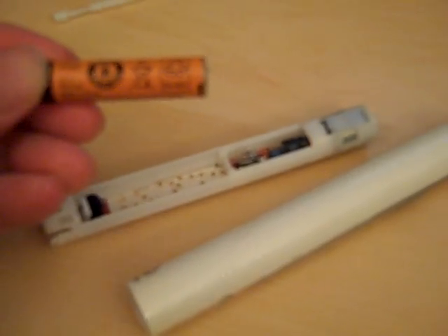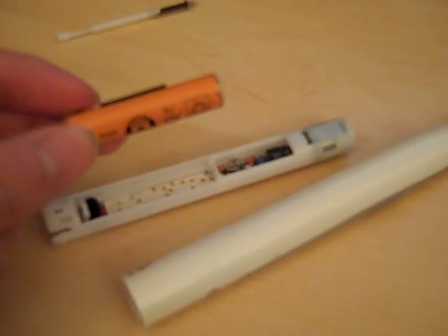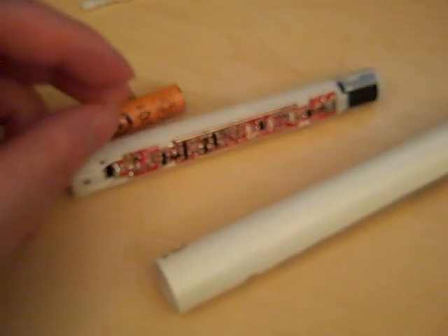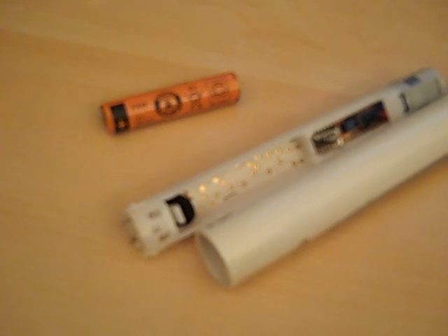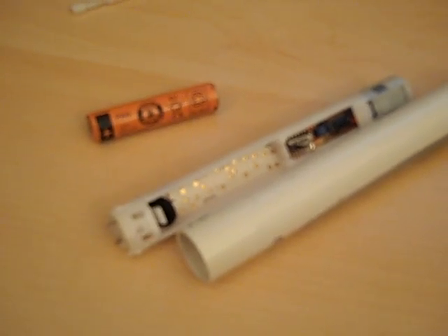To my surprise, when I took this out, this is supposed to be a 1.2 volt battery with 700 milliamp hours, and the battery is supposed to last three to five years. My toothbrush gave out just a tad before that. When I used a voltmeter on it, I was expecting no charge — but the vibrations felt pretty strong, like it was fully charged. And the manual says overcharging this toothbrush was impossible. But when I hit it with the voltmeter, it read 2 volts. A 1.2 volt battery was somehow overcharged to two volts, and that's what was causing it to malfunction.